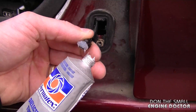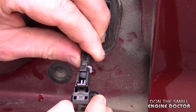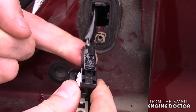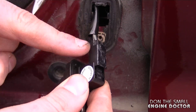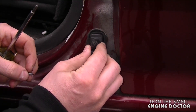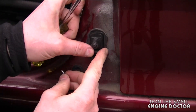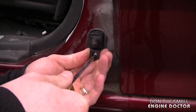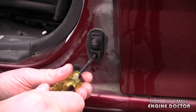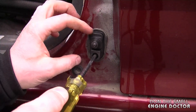The dielectric grease will prevent corrosion and moisture from getting in there. Plug the connector back in — you want the connectors to go in this way and you're going to hear it click. Spread the dielectric grease to prevent water from getting in there, then reinsert the switch — push it all the way in, push up and forward. It clips in on the inside. Now install the screw with the T20 Torx screwdriver; don't over-tighten it, just put it fairly snug.